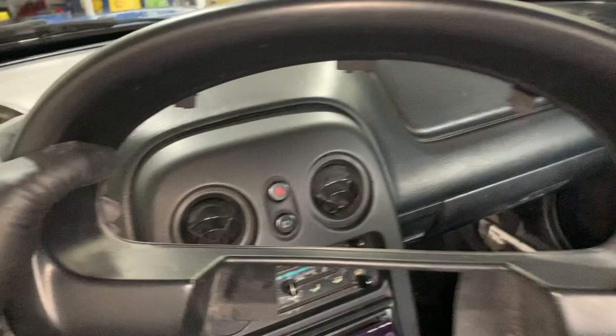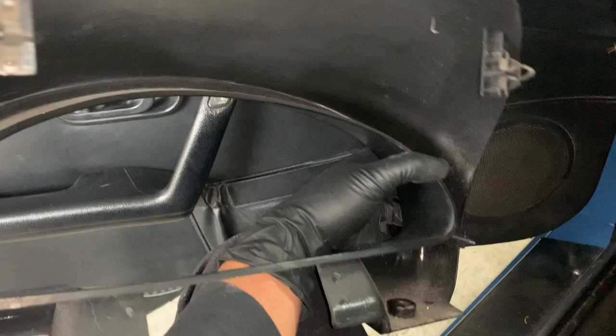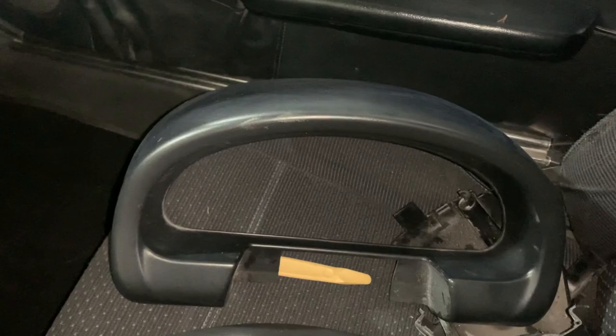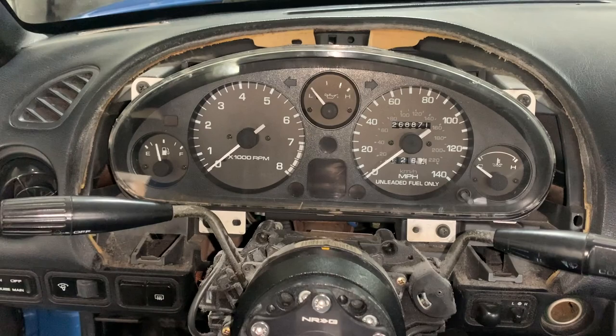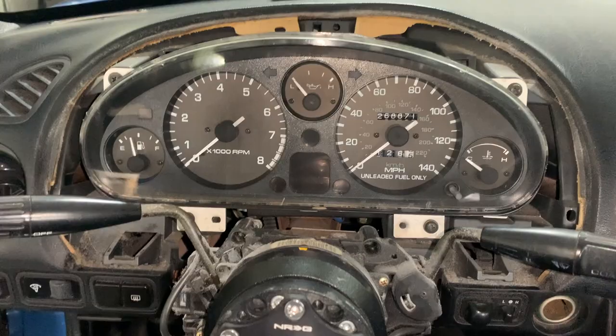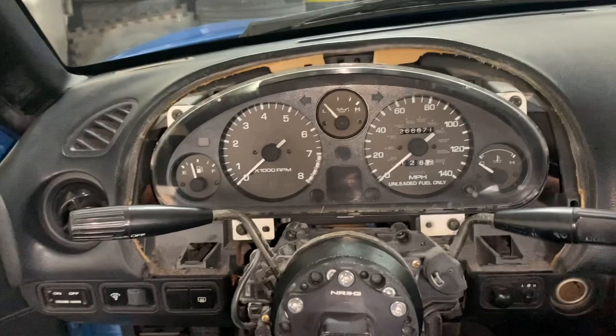Just like that the hood is removed in one piece. Going around the back you had those two fasteners at the bottom, and then there are three spring retainer style clips that clip it to the rest of the dashboard. I'd say either have a new one on call in case yours cracks, or with those spring style clips you kind of have to pull with a purpose — use both hands with equal pressure on both sides. You might notice the stalks are in the way — just rotate it off to the side and it slides right out.